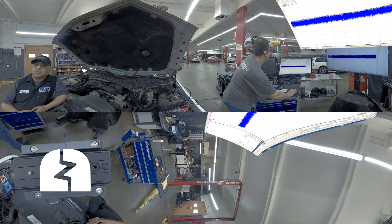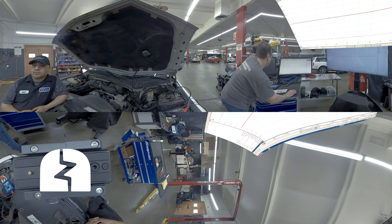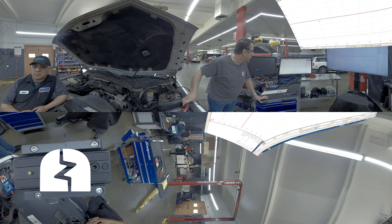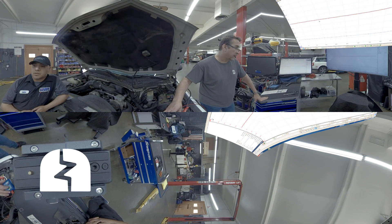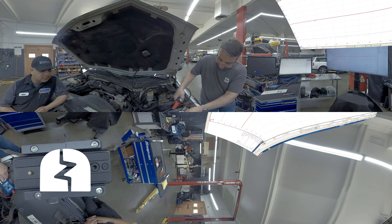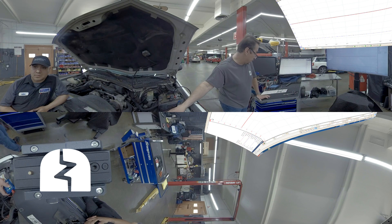Now about the noise question — this thing went to auto-scaling mode again. It says minus 5 amps to 50 amps. You see how noisy it is? You can actually filter that. You can click low-pass filtering and it puts a nice clean signal. Where's our ground at? You see that little horizontal bar — we can hit the zero button and it'll put it right on zero. And then I want to just turn it on. If we see this go negative, then we've got to flip it the other way. It went down to the bottom, so we've got to flip it — we're going to flip this over.